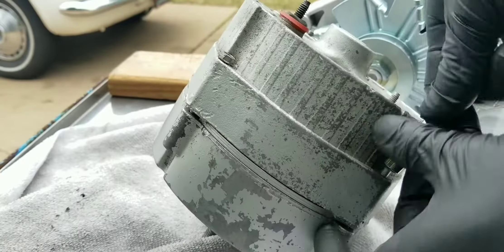Battery is measuring at 11.9 volts, so we're going to go ahead and start it up — and if this works, it should be charging and we'll know. About four pumps of gas and a little bit of tapping the pedal — got it running. Let's hook up the voltmeter real quick and see if she's charging. 14.6, baby. We are charging!